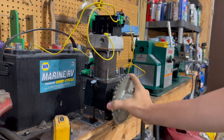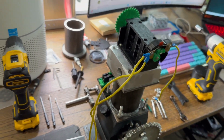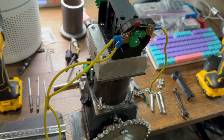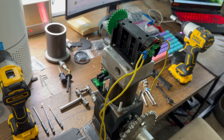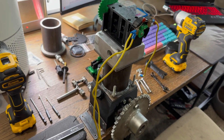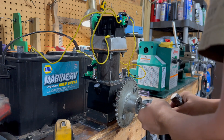We blew a hole through the piston — wait, I took the engine apart and everything is fine inside. It just blew the cork gasket out — you can see it in the video, it shot out the front. I need to find something better for the gasket. Everything else seems to be holding up surprisingly well, but I'll need to find something better than cork for the head gasket material.